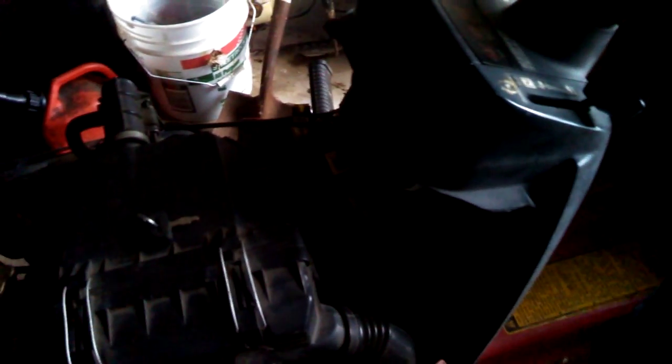It's windy out here. Well, let's walk over to the Honda here. The Honda figured out the draining problem. It's the voltage regulator, which is located back in there. I got it unhooked. Letting it sit. Make sure the battery's okay and hasn't fried itself from being drained so many times. So, gonna get a voltage regulator for that eventually.